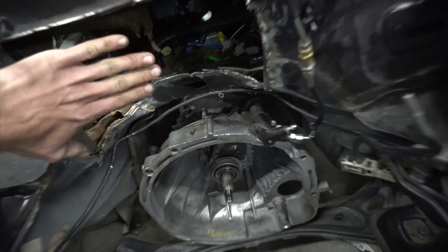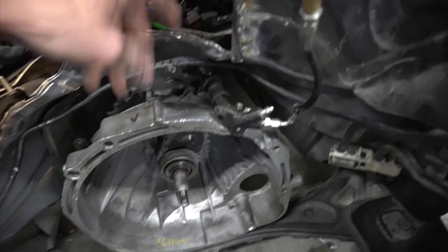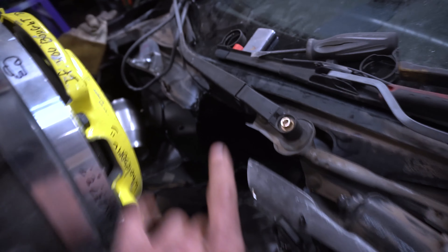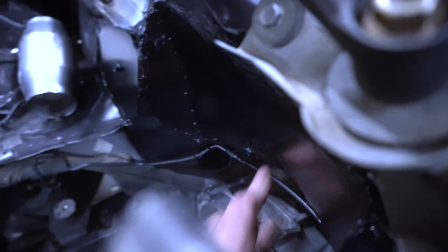Got the front patches in, now I need to make one for the back side which is going to be a little weird. I did hammer this up — didn't have to, but it gives me more clearance for all this stuff and makes serviceability easier, which is the goal on this car. The firewall notch is all filled in — welded about every inch or so, tack welds and little bead seams, seam sealed all the edges so it's nice and solid. There's still one small hole from HVAC stuff which I'll just glue a plug back into.